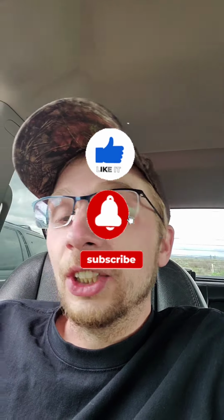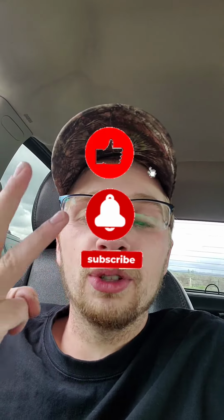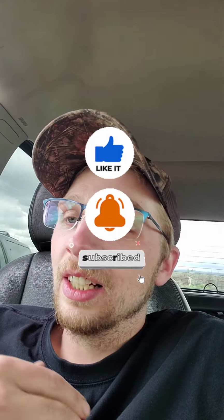It'd be better to change fluid than it is to replace transmissions, torque converters, engines, drive lines, and differentials and all that stuff. So change your fluid. It's every 30K. Differential, coolant, brake fluid, power steering, transmission. If you can, get your engine oil in there every 5K or less. That's only benefiting your engine and your car. So, if you can't do that, you can't afford it, well, it's all right. You're just going to have to be paying for it on the long end.